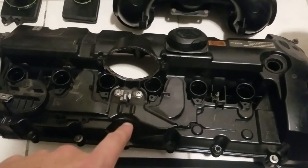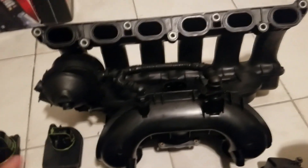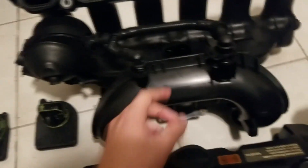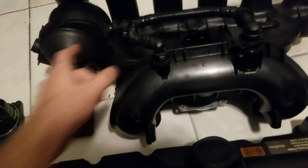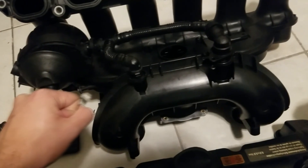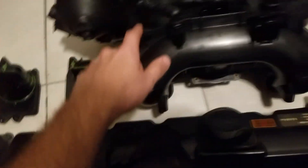That covers the metal valve cover cars. Now let's say you have a 328i. The 328i has a hose that goes straight from the valve cover to the two ports. Say you got a manifold from a 2006 330i that's an early model — so it has a single port and an outside oil separator. Your 328i has a hose meant to go straight into two ports, but you only have one port. You plug one of the hose ports, closing off the other, similar to the 325i situation.